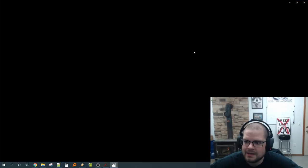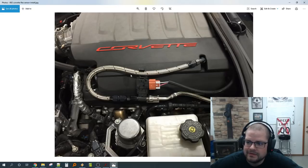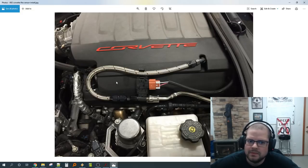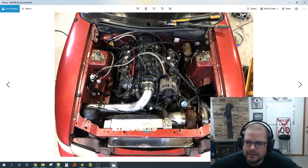Here's an installation on a Corvette where the sensor is on the feed line. They took the feed off and looped the feed through the sensor — the fuel is touching it and going back into the car. This is probably a stock ECU application. On the 8-for-8 Mustang I built, we also have it on the feed line. Another option is after the fuel splits to both rails and comes out, hitting the flex sensor before the return.